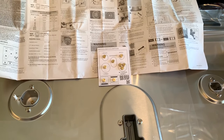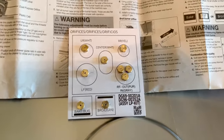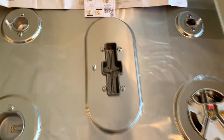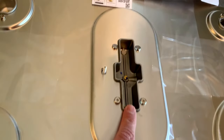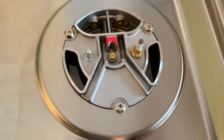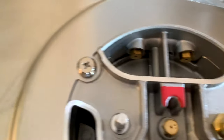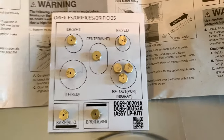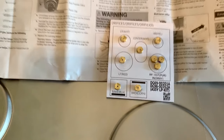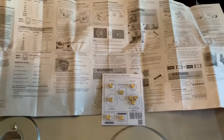All Samsung gas ranges ship with a conversion kit. Here's a picture of the kit — it comes on a little card with all the various orifices laid out the same way as the cooktop. You can see labels for left rear, right rear, and they're physically located in those spots. The center burner is right there, and the right front burner actually has three orifices: a large center one and two in the rear. There are also bake and broil orifices. The only tool you need is a seven millimeter socket wrench.